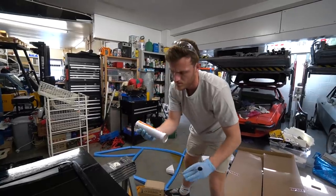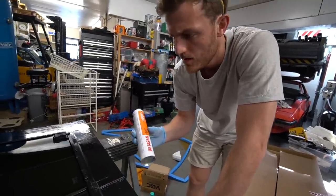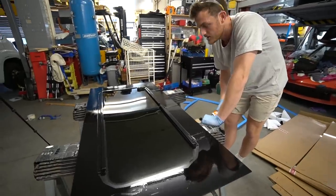To apply this adhesive — apparently you want to put it in a nice thick bead all around the window, because we don't want any leaks coming through in a week's time.